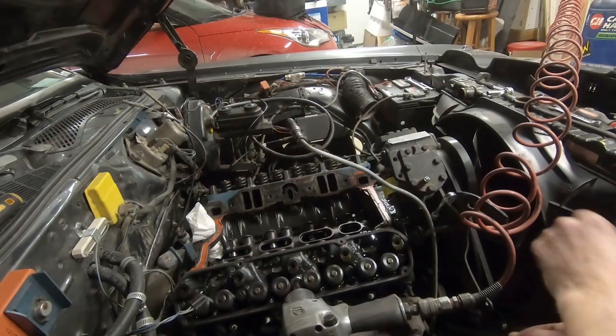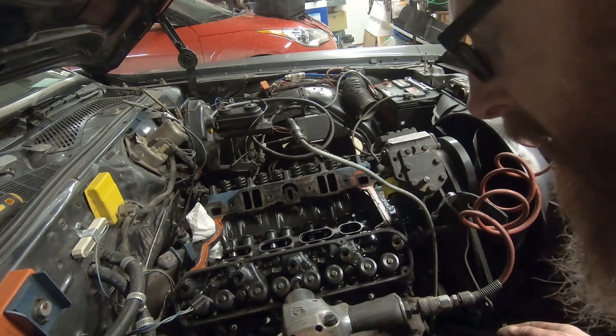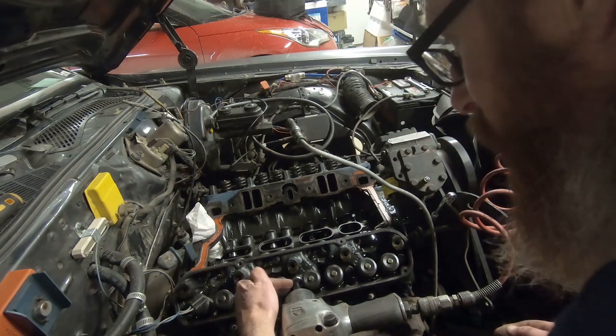What I'm up against right now is that I found one head bolt I cannot use an impact socket on because it's too thick, and a second head bolt I can't get to because the manifolds are in the way. Thirdly, I don't have a thin-walled three-quarter socket here because I left my tool kit at work. So we're going to take a quick pause, get the proper tool, get those manifolds off, and pick up right where we left off. We did manage to improvise and get the bolt out that was behind the manifold.